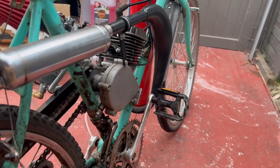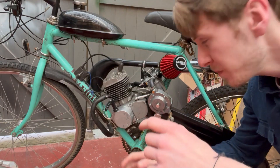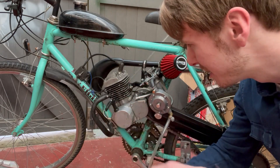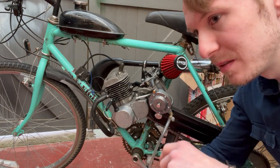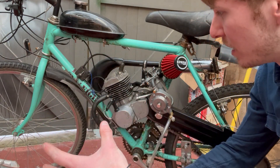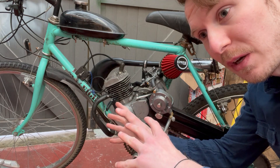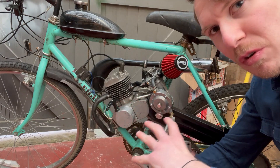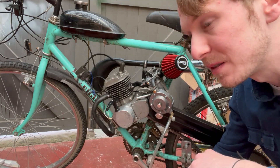That's running on the exact same carburettor as the four-stroke ones, as I mentioned earlier. I've now put some four-stroke engine oil into the crankcase just to see what would happen. Obviously there's nothing major scientific going on here — this might add a little bit of extra lubrication to the piston, but more importantly it's reducing the backfire from when the explosion goes off in the combustion chamber. I believe we're getting a little bleed-through past the piston rings, especially when the engine's cold. I think the oil is actually helping reduce those backfires, at least a little bit.